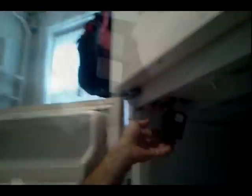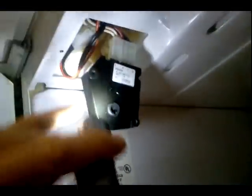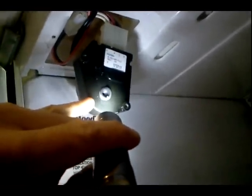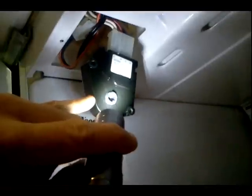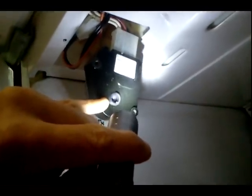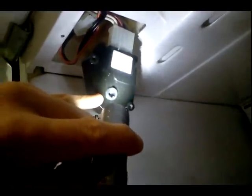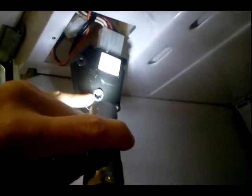I just took apart this compartment — that's the only conspicuous thing here. All I did was give that a quarter turn to the left and it clicked. Plugging in the fridge, the fridge fires up. So this is the reset switch. Your reset switch for the compressor may be somewhere else in your refrigerator, but for this model it was in here — a very conspicuous click once you give it about a quarter turn.